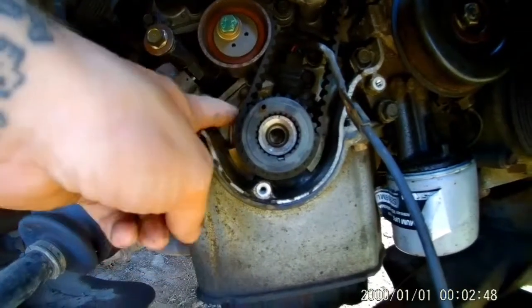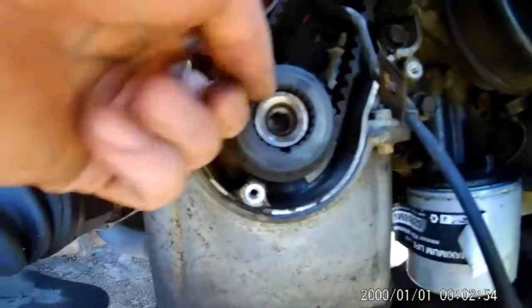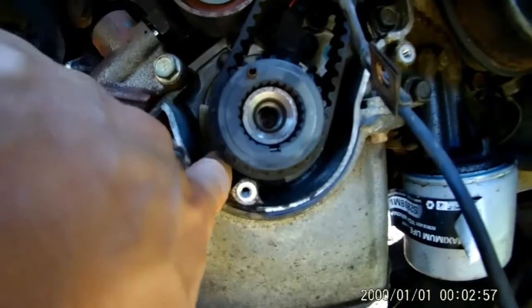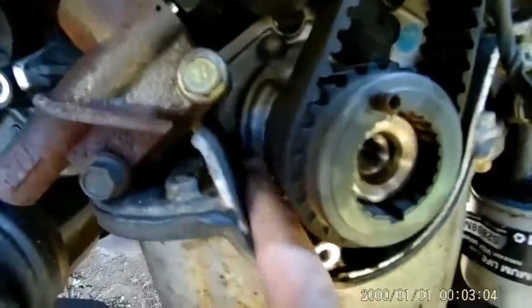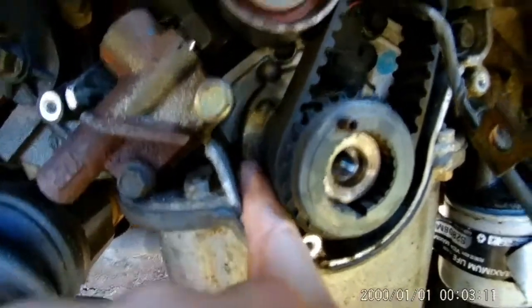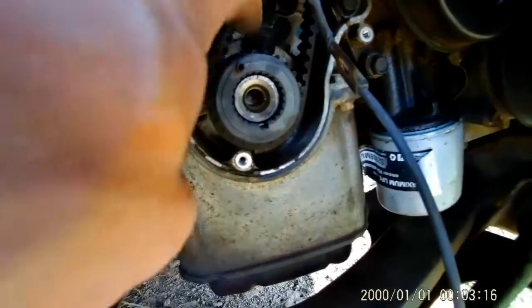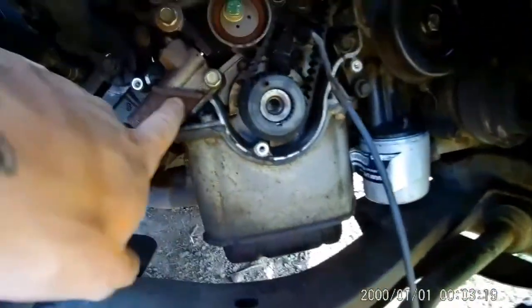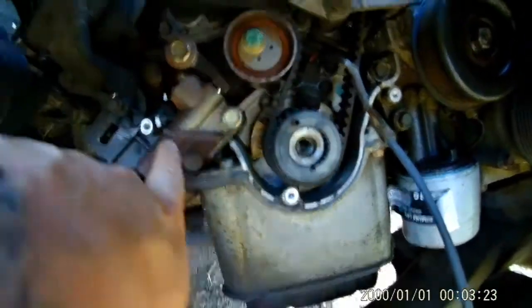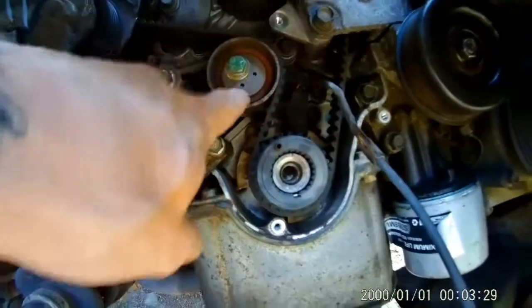If you can tell, mine has a plate in the back of it and it's not supposed to move. So this is what my problem is — it's like the welds have come loose, but it's not supposed to do that. So I have to replace the actual crankshaft sprocket. I'm going to have to replace that whole thing, making this a job where I will now have to redo the timing belt as well as the hydraulic tensioner. And I may go ahead and replace some of these other pulleys that are in there.